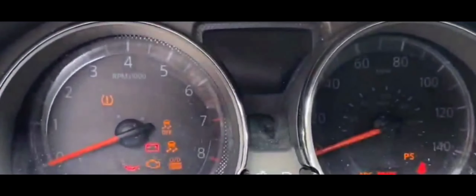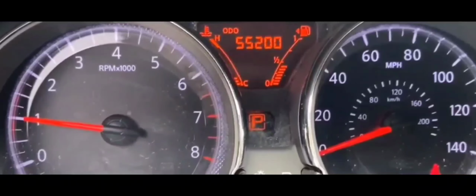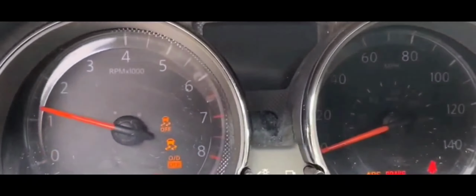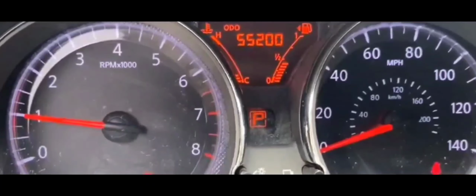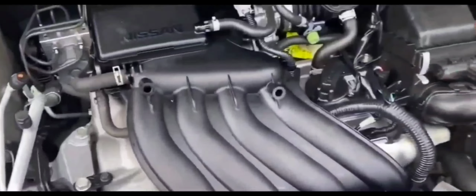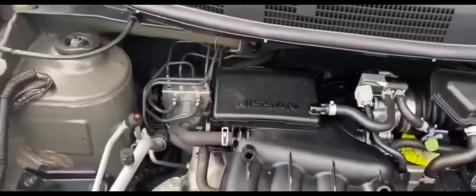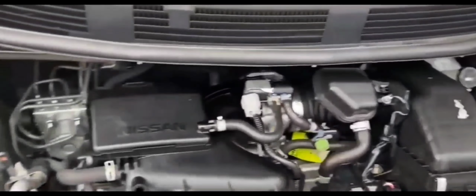So I was thinking to myself, maybe the Noco doesn't have enough power to start it. But then I was like, you know what? No. Even if it didn't have enough power to start, even if it was at 25%, the car would have made a slow crank, or at the very least I would be getting some lights on the dash. Even with a 10% battery pack, once I pop it on, I should be getting some lights or whatever, stuff that doesn't take a lot of electricity.